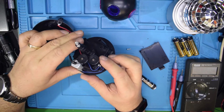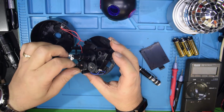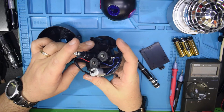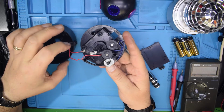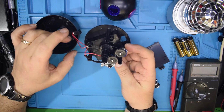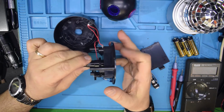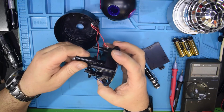It's quite unusual that they're using belt pulleys on the motor rather than gears to actually drive this thing. As you can see, the 2 diddy LEDs are poked in the top. So you've got the LEDs. Looks like a resistor in there to bring the voltage down. Yeah, there's the battery through the switch to the resistor. One leg goes to the motor, one leg goes to the LEDs, which are on this stick. Now that's the rotating spindle, so if I remove the belt, that loosens that.